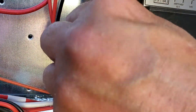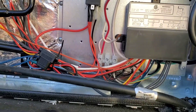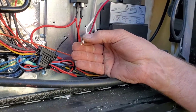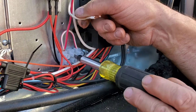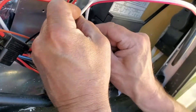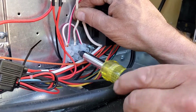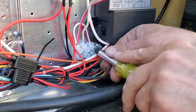That wire is way too long, so I'm going to get a pair of side cutters. My lovely assistant is going to stand here and make sure the wire doesn't touch anything. We'll cut that down to length and re-twist it. I was also changing the USB chargers in here — they're only 1.2 amps or something like that. I bought new ones, and when I pulled one out the wire came right out of the crimp they used. We'll get that one done too.